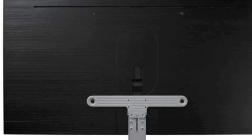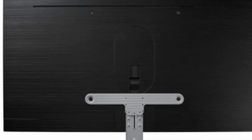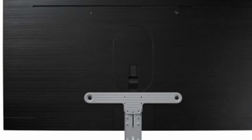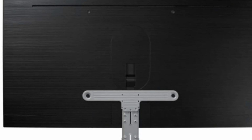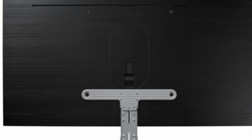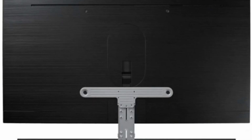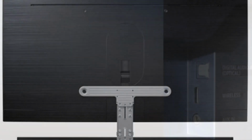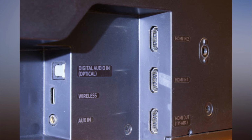There are 11 drivers inside the soundbar enclosure, each of which is powered by a discrete Class D amplifier. The woofers get 50 watts per channel and the tweeters get 20 watts per channel. The front right and left channels each consist of a pair of 115 by 62 paper diaphragm mid-bass drivers, coupled with a single large, 52 mm, aluminum inverted dome tweeter. The center channel consists of an identical configuration. That accounts for 9 of the 11 drivers.